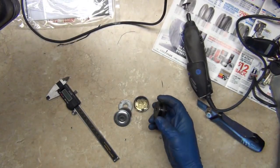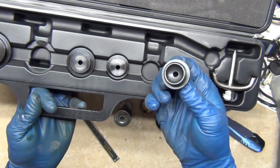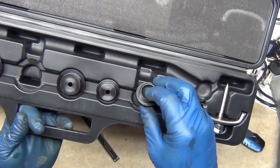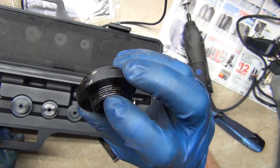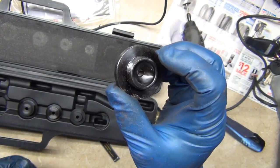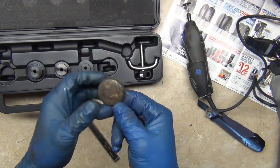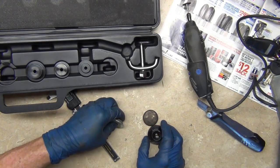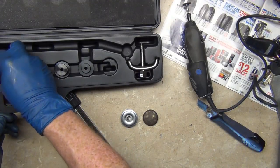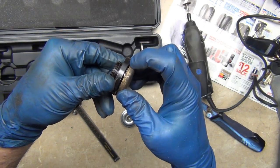I'm having the hardest time getting this stupid freeze plug in, so I bought an OTC Stinger set — it's a freeze plug driving kit. It's like a front wheel hub bearing press where it's got all these tools, and then it's got a round ball on a rod that you knock them in with. But the problem is I don't have the access to make this work. You can see where I've scratched the tool up against the motor mount on this boat. I don't want to pull the outdrive to pull the motor, to pull the motor mounts off to put a freeze plug in when they're not all rusted and I just have two of them that I need to put back in. This is the driver for the freeze plug — it's an inch and a half. You can see it doesn't fit all the way and this stands off a little bit.